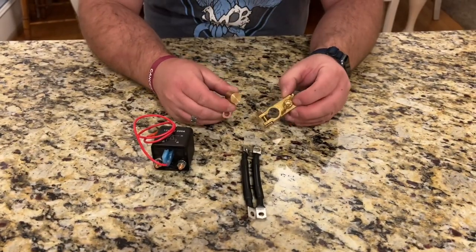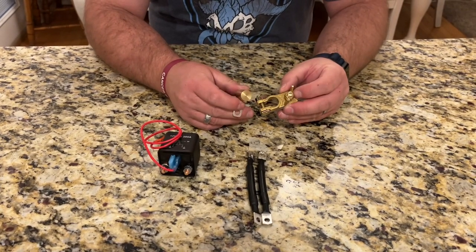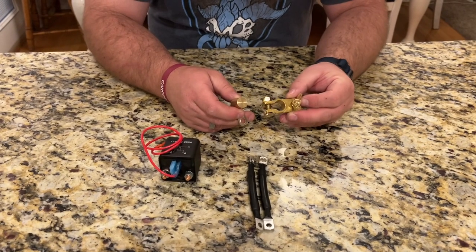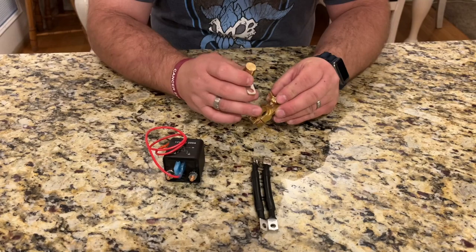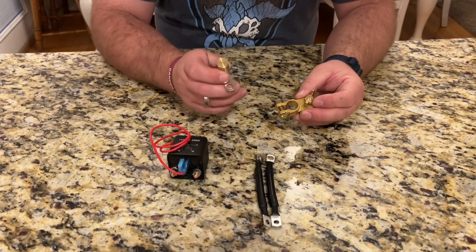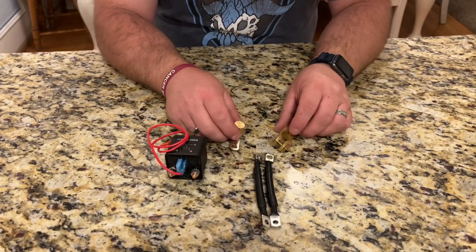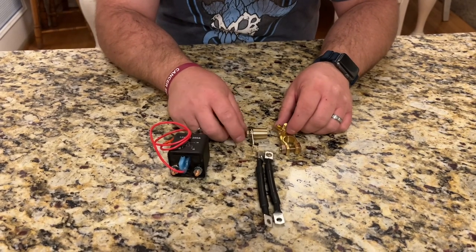Keep in mind that this is designed to be connected to the negative terminal — that's the line it's going to break — and this is only going to fit on a 15 to 17 millimeter style plug. You're going to connect one terminal to the battery and put the other one into the cable, then use these wires to connect it all together.